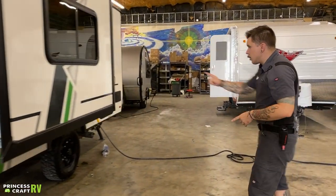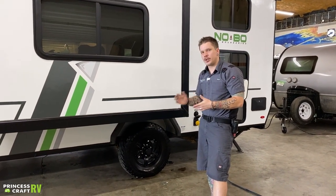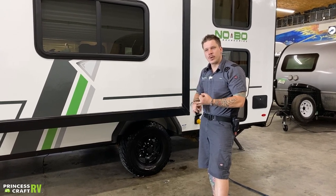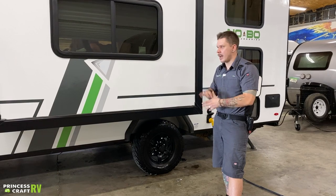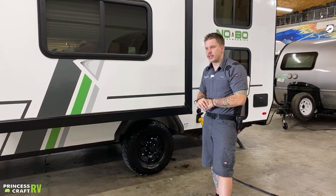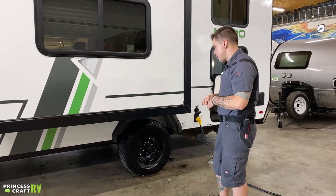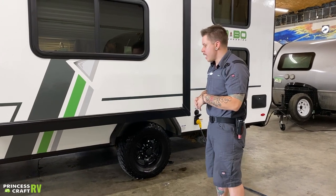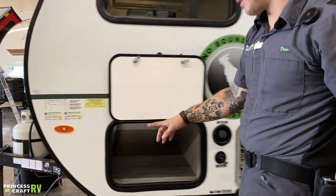Moving on here brings us to our tires and our lug nuts. Lug nuts have been torqued to 100 foot-pounds here in the shop. Manufacturer recommends a re-torque procedure — generally those numbers are the first 15, 25, 50, and 100 miles of initial travel. It is very important that we check and make sure those lug nuts are maintaining that 100 foot-pounds of torque. From there on out, the manufacturer recommends at the start of each trip that you check and make sure they are again maintaining that 100 foot-pounds of torque. With tire pressure, we run all trailer tires at the max tire pressure rating. You'll find that information stamped on the sidewall of the tire itself but also on the data tag here on the front of the unit. What we have here is going to be a 65 PSI max tire pressure rating — that's going to give us the highest flexibility in terms of weight rating whether we are completely full or completely empty.